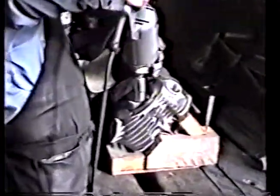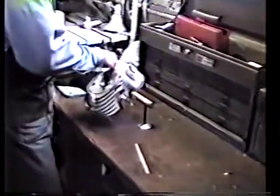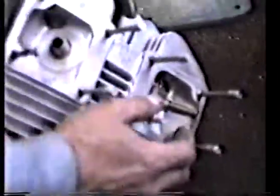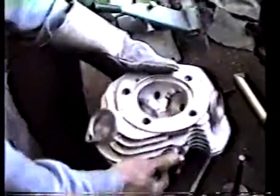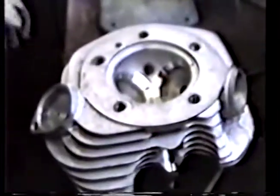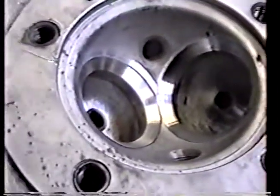I'm just finishing up this set, so I'll show you how it goes here. Then we check it for height — a certain distance from the casting — and this one's right on the money. I can grind these things within five thousandths by eye using this ruler. That's what it looks like when the seats are roughed out to height.